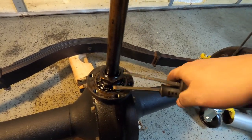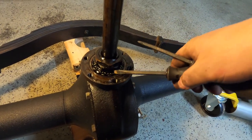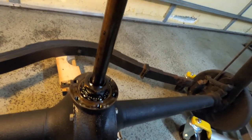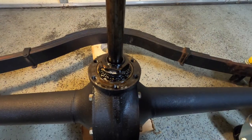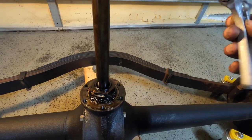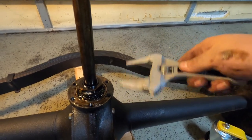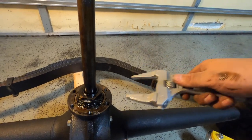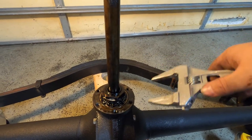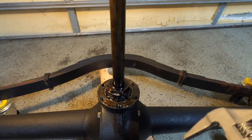Now that the torque tube is out of the way, we're going to rotate the driveshaft around. There's a metal retainer on the bottom of the top nut that gets folded down and holds it in place, so we need to find where that tab is bent up over the top nut and knock it free with a screwdriver. With the tab bent out of the way, I'm going to use these cheap large-mouth adjustable wrenches I got off Amazon — about nine bucks each, two and one-eighth inch. I'll take the top nut off while being careful not to disturb the bottom nut.